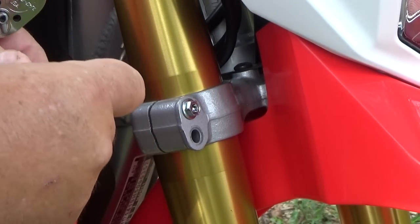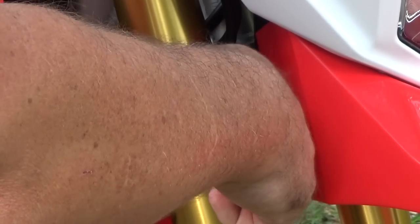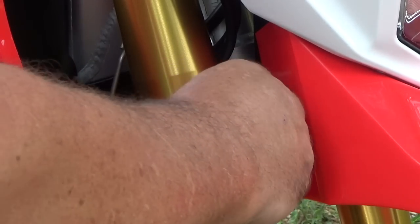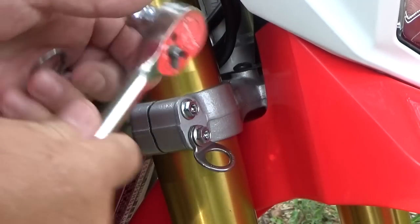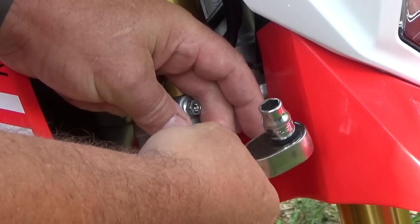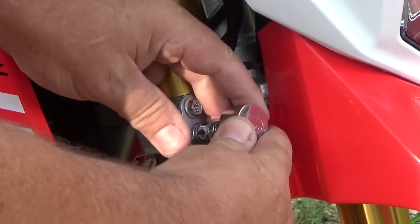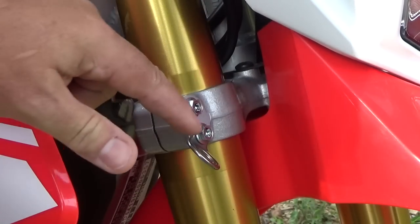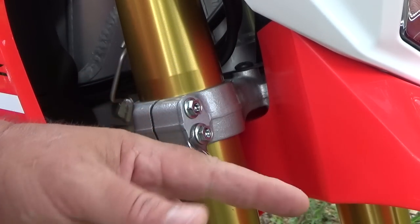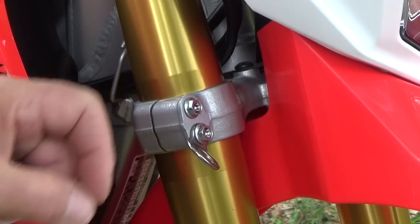Stick this in here. You'll want to snug this up, and then take a torque wrench, look at your specs, and torque these triple clamp bolts back to factory specifications. Right now we'll just snug them up. I want them at an angle like this — if they're straight down and my cables are pulling to the side, it will probably try to slide this. So I put it at an angle to start with.